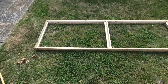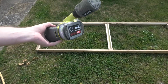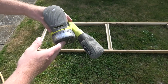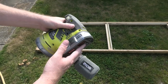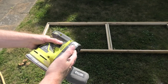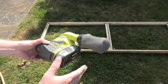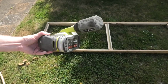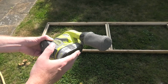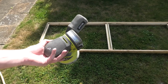So the sucker blower over there was one Ryobi tool, and we're moving on to the next one. When you have tools like this that use batteries, I have 5 batteries for my Ryobi tools, and I picked this one. This is one of the smaller batteries, but it's very important to have a rotation on them so that they get used and charged up. That makes them last longer. If you have them sitting for too long, especially if they are not charged up, they won't last very long. The batteries inside will get out of balance, and the electronics inside will just shut them down because they are too much out of balance. So use them and charge them up.